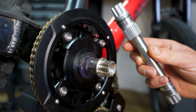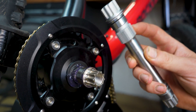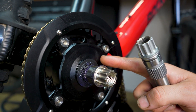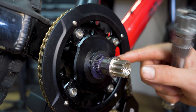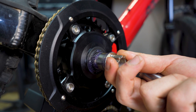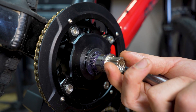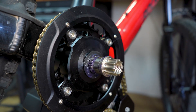One important thing to note: there's a spline on the spindle that's supposed to mesh with the torque sensor inside. When you put in the spindle and it becomes difficult or hits a hard stop, the splines may not be aligning. Sometimes you need to locate the splines — if it's not fitting in, move it a quarter turn and most likely it will go in.